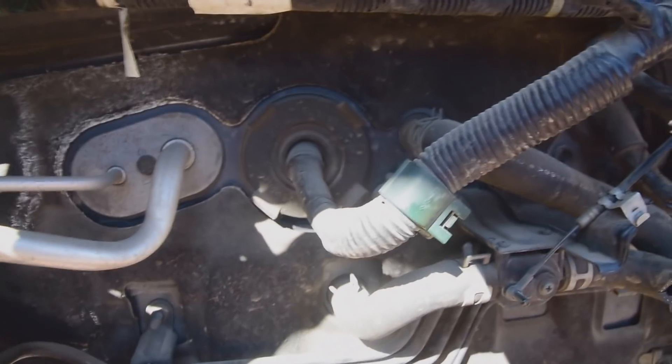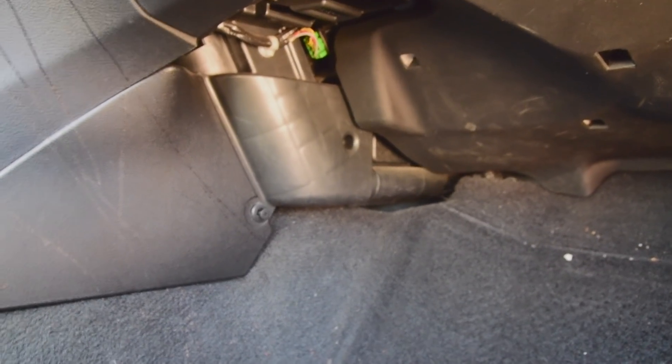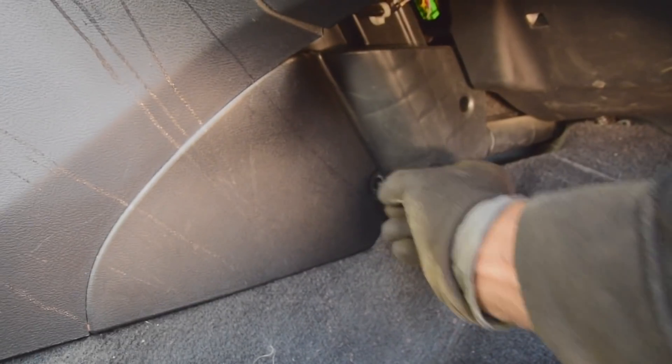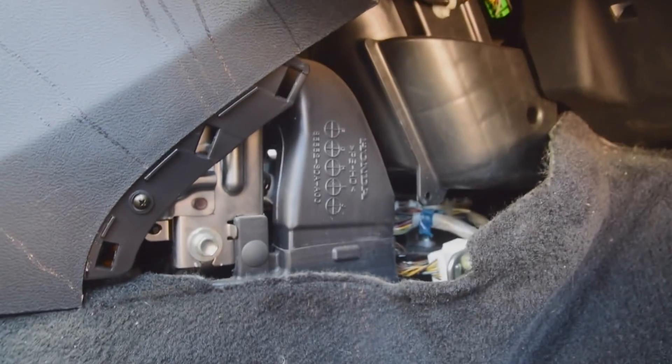One of the last things I'm going to grab right now is that thing right there. Now we have the ECU and the shift knob left to do. Where is the ECU on a TSX? Because I don't pull the ECUs out of these, I actually don't know where they are. We'll follow the factory wiring harness through the firewall — there you can see it. So maybe just on the other side is where we can locate it, which puts it somewhat central inside the car. It generally is right behind all these kick panels right here. We'll just go ahead and pull that stuff down — looks like someone's already been in here before. The cords sit right behind the carpet here, and there it is.